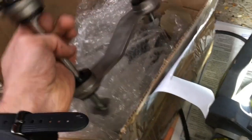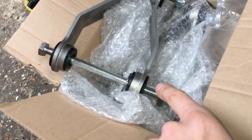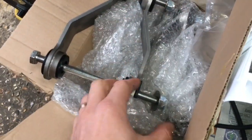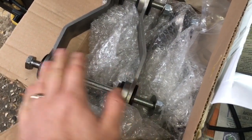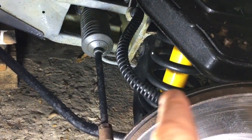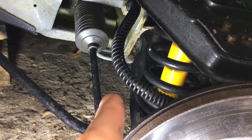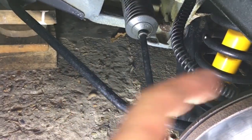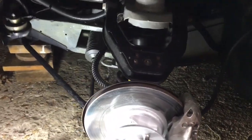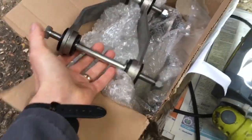The plan is to take the nut off here and then take the nut off this one, put it into position, and basically knock this bolt through to knock the old bolt out. That way I don't disturb any of the washers, spacers and bits and pieces in there — knock it out from this side, then the new bolt goes straight in. This one I'll knock out from this side here. It's got quality and loads of extra strength, so let's get those in.